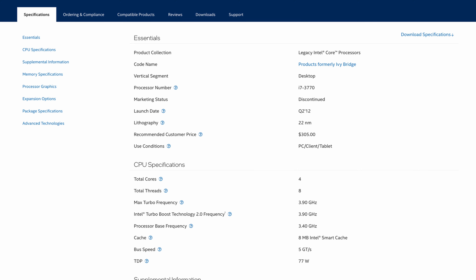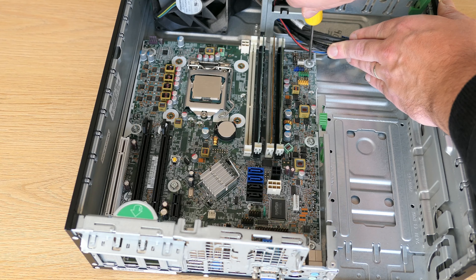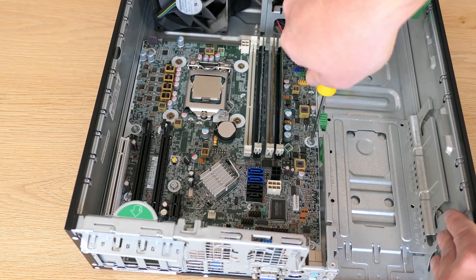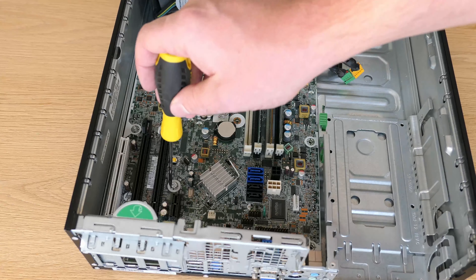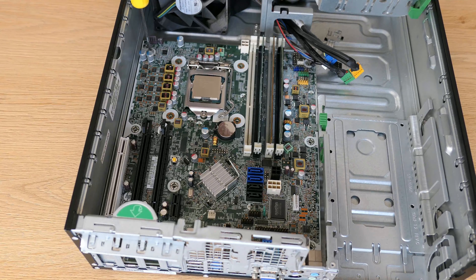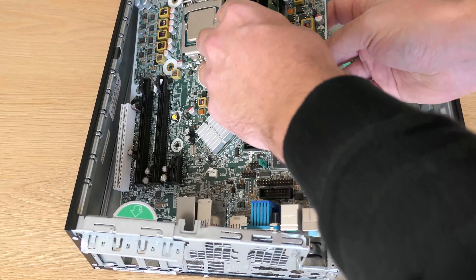The same can be done with the power supply, and as you can see the hard disk is placed under there. Let's start disassembly with the biggest component — the DVD writer. After disconnecting it you can get it out by sliding it backwards and then moving it up. It doesn't always go very fluid but after a bit of wiggling it comes out. The drive bay has a mechanism that holds the drive in place with four screws mounted on the drive — no need to fix anything to the bay itself.